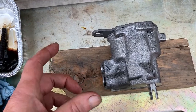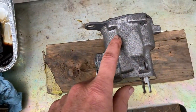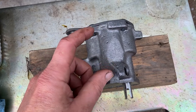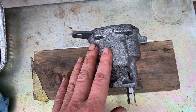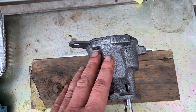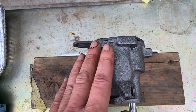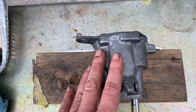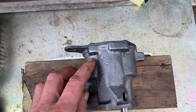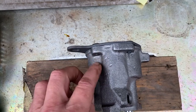Notice how I'm not saying boosting your pressure. The difference in pressure would come from the springs in these units — the spring is what determines pressure. So even though this is a high volume pump and it will increase your oil pressure, you're not actually using the spring for the pressure. You're using just the volume to increase oil flow. That's why I'm putting it in.